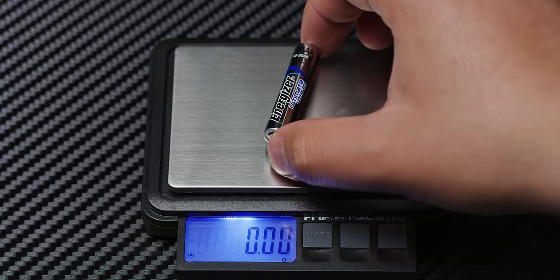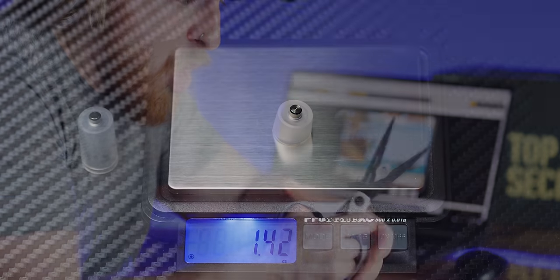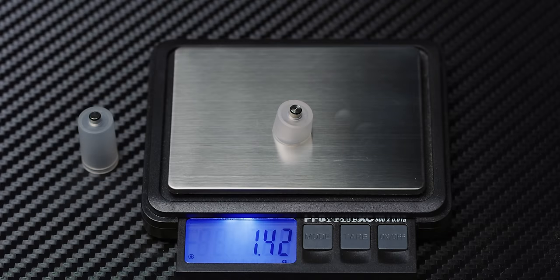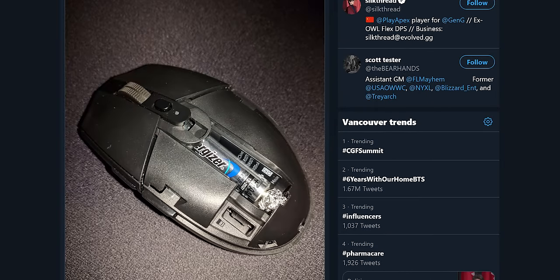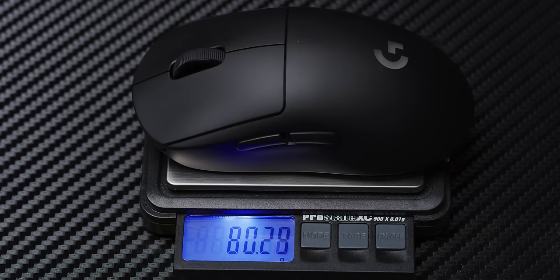For me, the stupid-long 250-hour battery life is honestly a bit unnecessary. I'm personally a fan of using a standard rechargeable nickel metal hydride AAA battery with an adapter, giving about 100 hours of rechargeable life at about 86 grams. However, the lightest option is actually a AAA lithium cell at just 7.5 grams for the battery and an additional two grams for an adapter — or you can use a small tinfoil ball and some tape to make it even lighter. This setup brings our total weight down to just 82 grams, only two grams heavier than the G Pro Wireless, at nearly a third of the price.